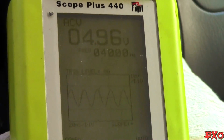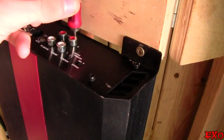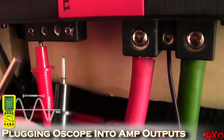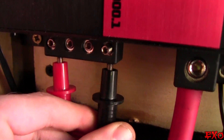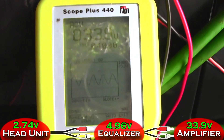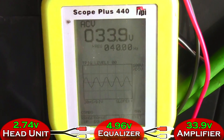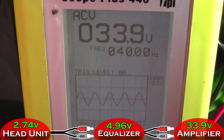So now let's go to the back and work on the amplifier. We just tested these RCAs for a nice, clean signal at 5 volts, so I'm going to go ahead and plug them in since we know it's safe. Now we're going to go on to the outputs of the amplifier. I already have one plugged in, but I'm going to go ahead and plug in the other to the O-scope so we can examine the final sound wave to make sure everything's nice and round. We got this running right now, and she is putting out 33.9 volts at half gain right now. So let's go ahead and see if we can turn this up a little bit without clipping. The wavelength looks pretty good right now, so let's see if we can increase it safely.